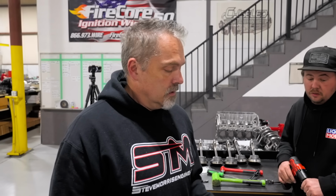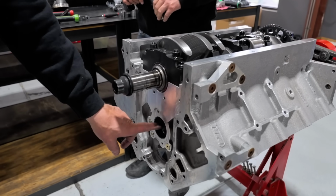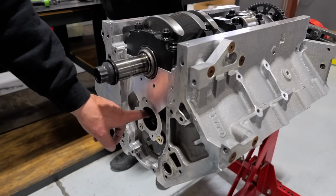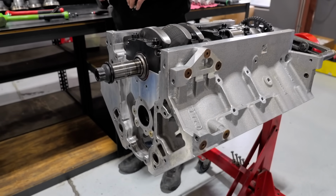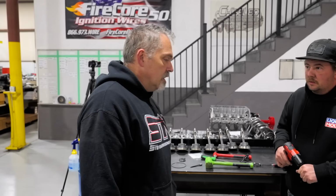My personal opinion, there's not much sense going to 60 millimeter, 65 millimeter, whatever you want to put in it. The 55 millimeter just makes a really good cam core. Proven out, everything's great. Raised camshaft, so that means that from here to here is taller, higher dimension. Really keeps the rods from hitting the camshaft on big strokes. So as soon as we get this crankshaft out of here, we'll see exactly what the stroke is, because I'm pretty sure it's 4250. And yeah, we can figure out the math here.